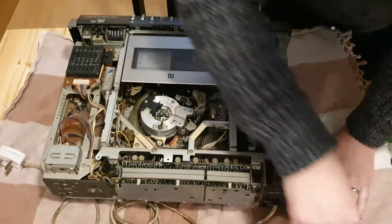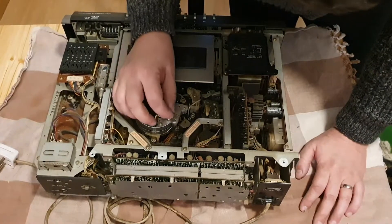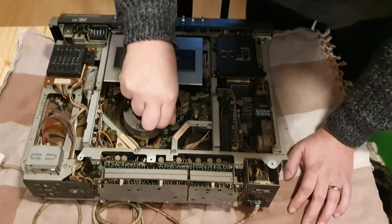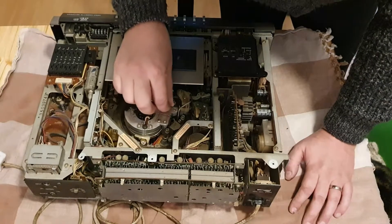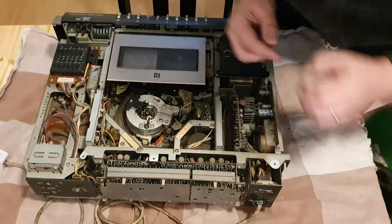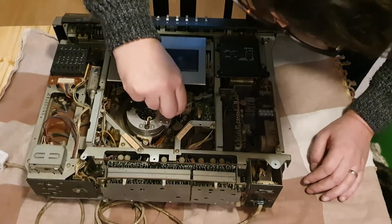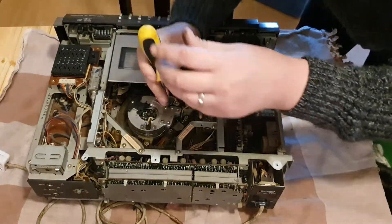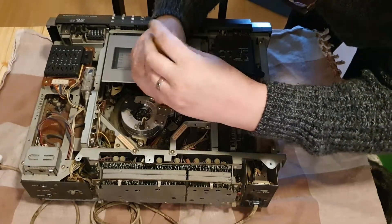What I will do is screw this upper head drum back on again, as we've determined that we're probably going to need to remove the entire head assembly itself and actually strip it down to work out what's going wrong. I've got a feeling that we may have some bearings in there which have seized, which would probably be the most likely explanation as to why we don't seem to have any drum rotation.